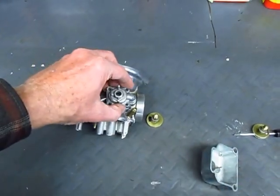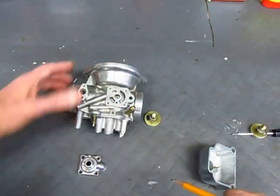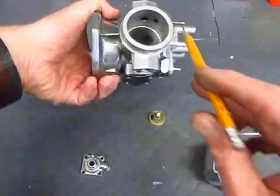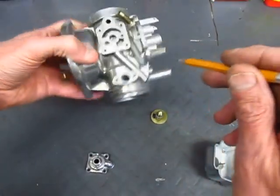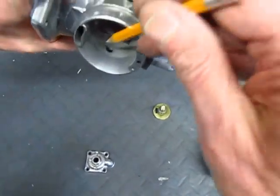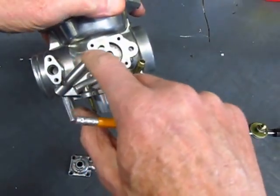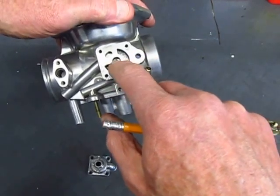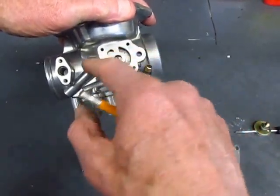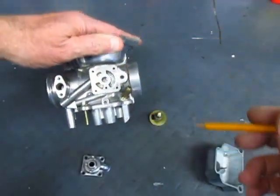The question is how does air get pulled into the choke chamber. The way that happens is this hole here is actually at a much lower pressure than this hole here. So when the passage here is opened up and connects with the inlet air passage, you have a vacuum that's pulling air into the choke portion of the carburetor.